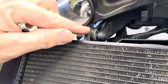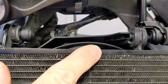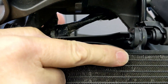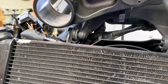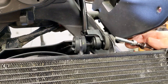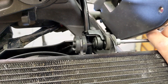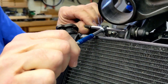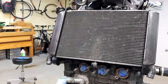I'm real close — the bolt is almost lined up and over here it's real close too. Now I can reach around and push on that rubber thing on the other side. So that's on there good. Now I can spin in the left bolt, then spin in the right bolt. Make sure you don't cross-thread it — finish spinning these in and tighten them down. Nice and snug. One radiator installed — now we just have to do the hoses down below.